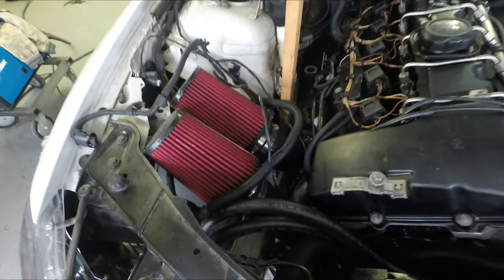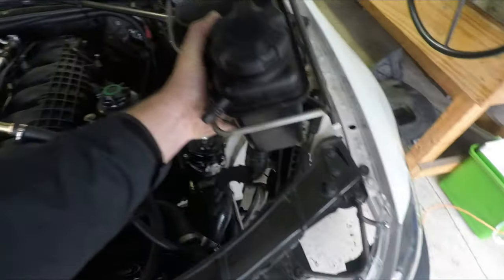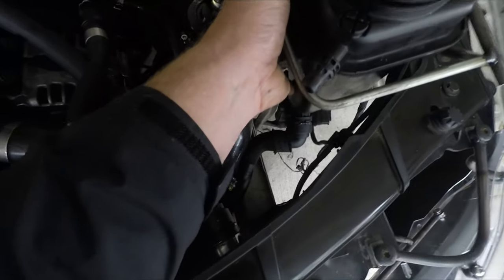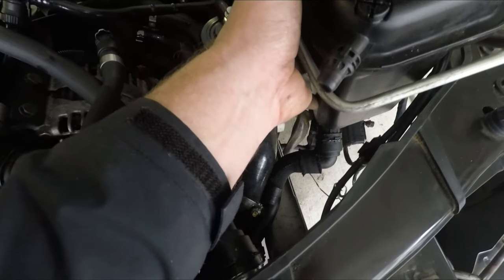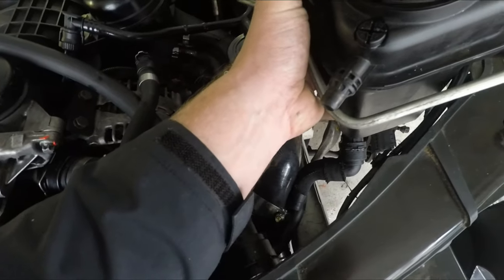But to do this, now I had to get rid of this thing, and originally I thought that I could get it mounted here, which is how I'd been driving the car around loosely. But the coolant lines in the bottom down there, which feeds the water pump, are in a position where they either get pinched or they're rubbing on the frame rail heavily, and they're stacking up between the power steering line, the charge pipe, and the heater hoses. It just wasn't going to work very well.